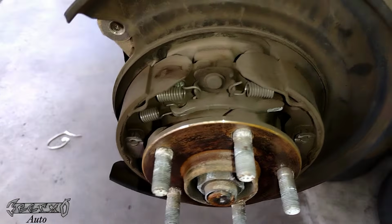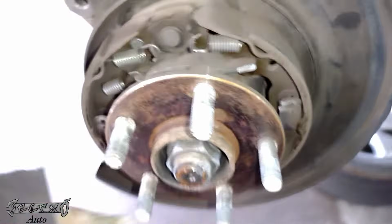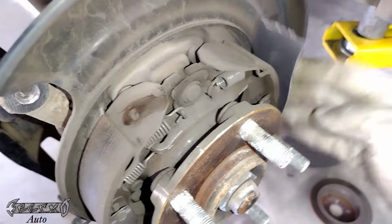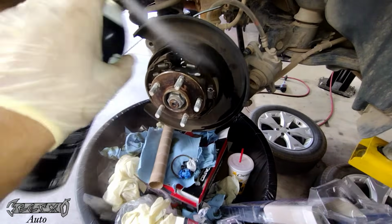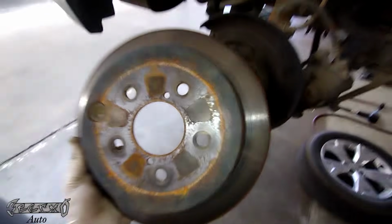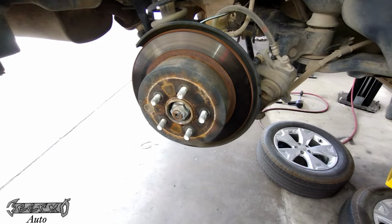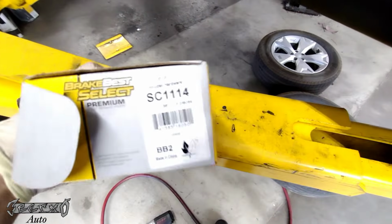Again, I'll put links in the description box. Here's your e-brake pads. Whenever I have these rotors off, I like to clean these up a little bit, just sand them down a little bit, and then shoot them off with some brake cleaner. Just keep them nice in there, you know. Don't go crazy with the sandpaper, just kind of scuff all the dust off. So pretend this is your new rotor. Your new rotor will go on like that. And you might have to adjust your e-brake pads in to get your new rotor to fit.